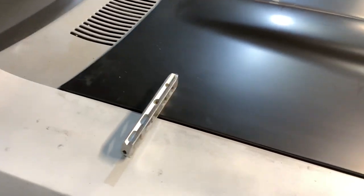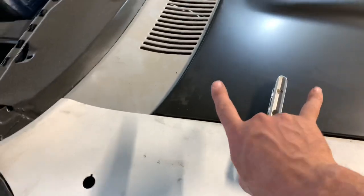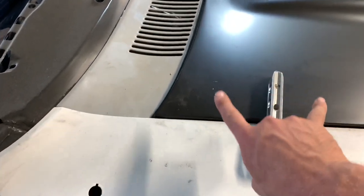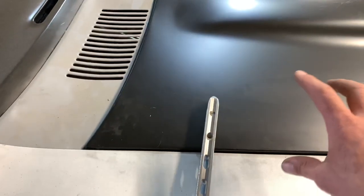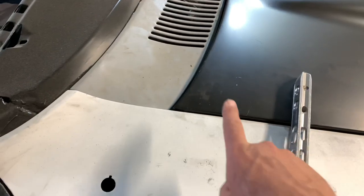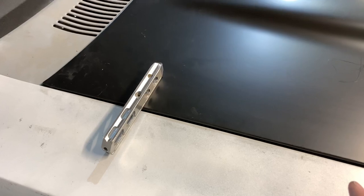It can be done. I'm going to show you how to do it because there are only two bolts for that hinge that adjust the position of the hood. Forward and back, they go on the hood here, so we'll have to make those loose too to wiggle things around. Let's get this hood height adjusted because it doesn't always work like we think it should.